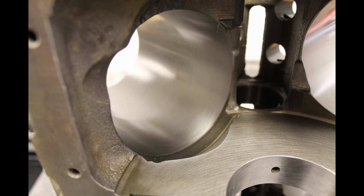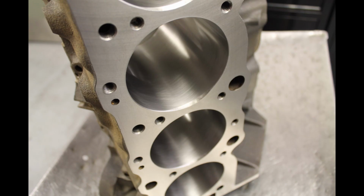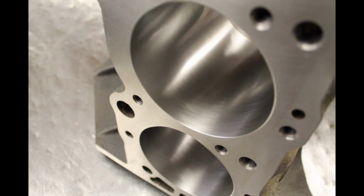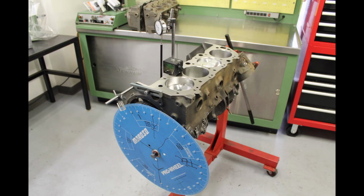We try to install it on a 105 to 106. Generally, we can get it in that area. And then we use a Morel lifter. And on the valve train, we'll use an .080 wall chromoly pushrod, Smith Brothers. We use a Comp 3/8 guide plate with an ARP rocker stud. And your rocker arms are a Scorpion roller rocker. And basically the intake, what we generally use is a Performer RPM Air-Gap. We do a little bit of work to it, nothing crazy.